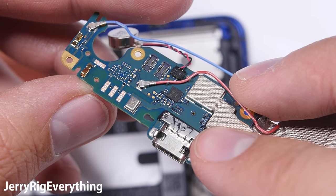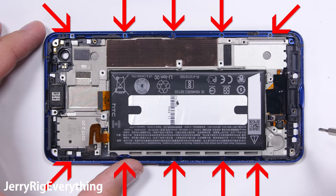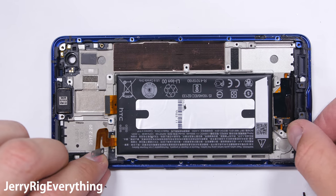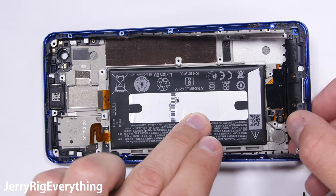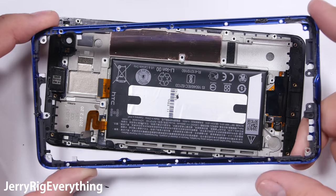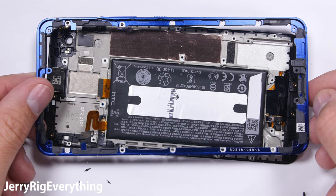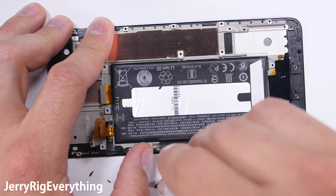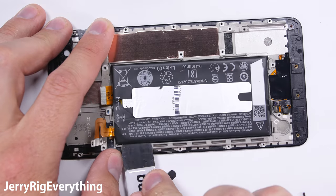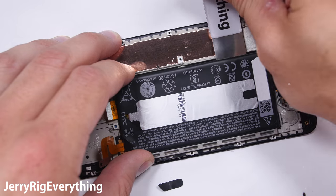If you are attempting a screen replacement, the metal frame is the next thing to go. There are 11 normal Phillips head screws holding this onto the screen. I kind of like this design because if your frame ever gets damaged or dinged up during drops, it can be pretty easily swapped out. You can even mod this thing pretty easily too. The battery is the next thing to go — no magic pull tabs on this thing, just straight leverage. Taking special care not to puncture anything, I can lift it out of the frame with the flat end of my metal pry tool.